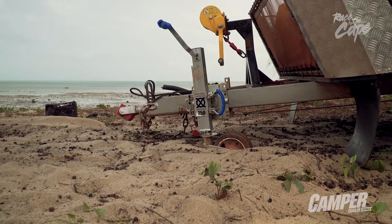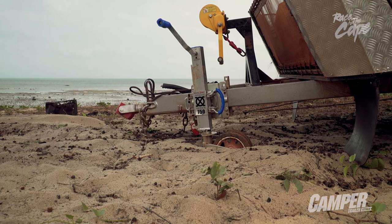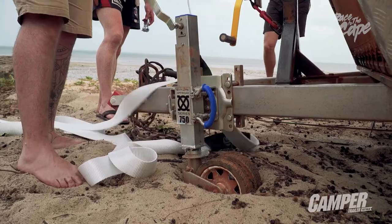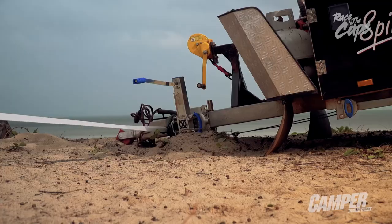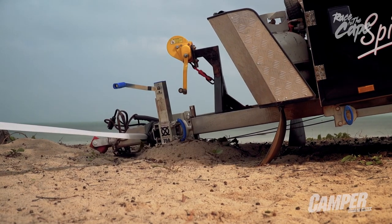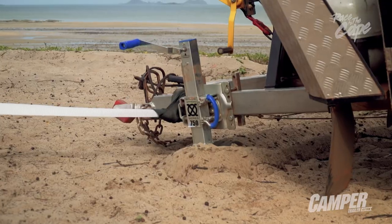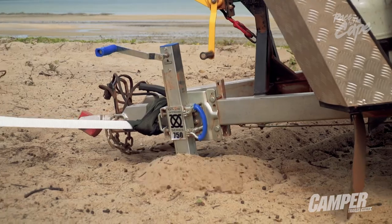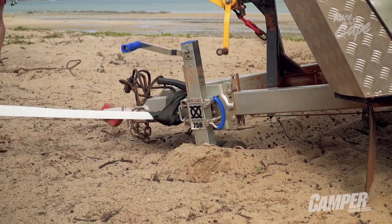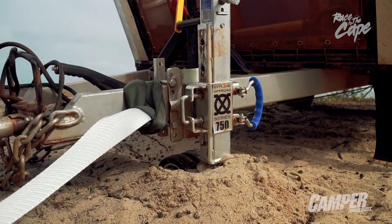We had the opportunity to test this ourselves. After sinking both camper and tow tug on the soft sands of Cape York's western beaches the night before, we soon realised the best way to free ourselves was tow tug, then camper. The 750kg EXO is sturdy enough to hold the full weight of the camper's ball weight, with a softer footprint than typical. We slung a strap around the camper, kicked the Prado into low range, and effortlessly pulled the camper out of a tough situation. A lighter-duty 500kg option is also available for lightweight campers.